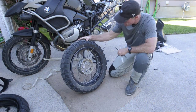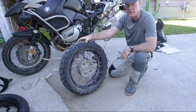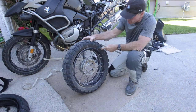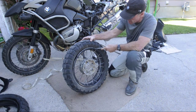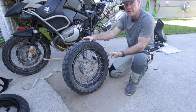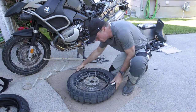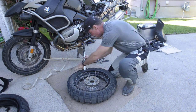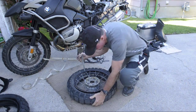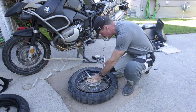When we're changing the tire, it's a good idea to usually start and end at the valve stem. In particular if you've got wheel tire pressure sensors built into the machine like this — it's kind of a large lump in there — you don't want to break that off. So you want to get the tire clear of that before you ever get started. We'll get a tire tool started in that area, push the tire down into the channel, and then you can break it over pretty easy.